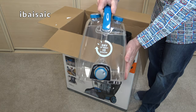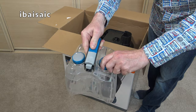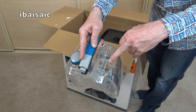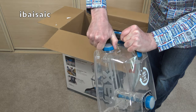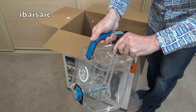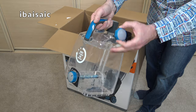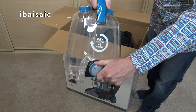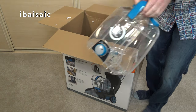Here is the clean water tank. With this particular model you don't even have to measure out the solution because you have a separate compartment. Warm water — you don't want boiling or very hot water, normally hand-hot is sufficient — goes into the main tank up to the max fill line. It's quite a large capacity, over four litres. On the other side you pour the solution in neat, no diluting required because the machine measures the solution for you. With this model you also have the option of a rinse cycle, so you can turn the dial and the machine will only dispense clean water if you want to rinse your carpet or upholstery after washing it.